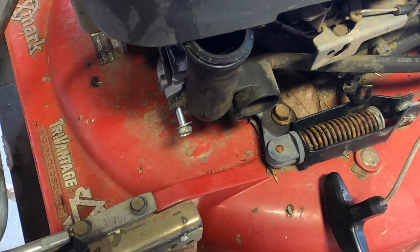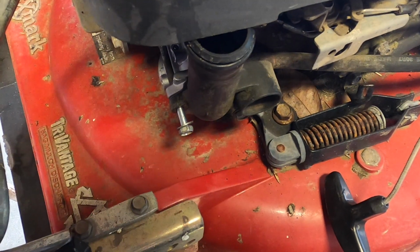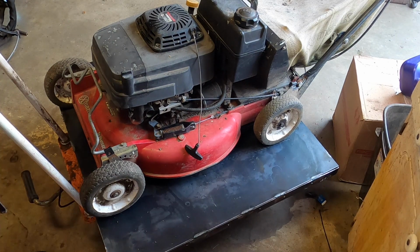Okay, I need to be where you are, so I'm just going to put this on. I'm going to wedge this in there and get it going. So, tip on doing this: when you tip it up, make sure you get the breather hose into its little socket. If you tighten it, you'll never be able to put that in. Got it installed.